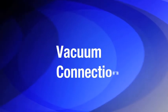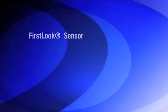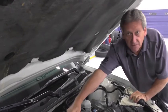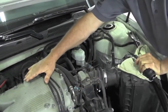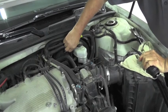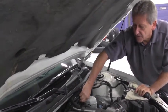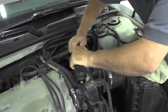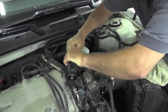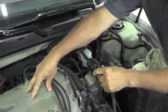In this next demonstration, Louie will show you how to make a vacuum connection as well as an exhaust connection with the First Look Sensor. We must first find a centrally located vacuum source that covers the whole induction system. On this 2008 Chevrolet Impala with the 3500 engine, we'll use the largest one, going to the brake booster — pulling it off the brake booster, taking our adapter and making sure we have a nice snug fit. This now couples it up so that our sensor samples the vacuum within this induction system.